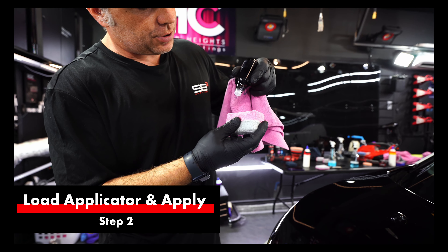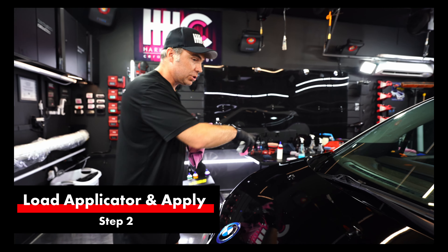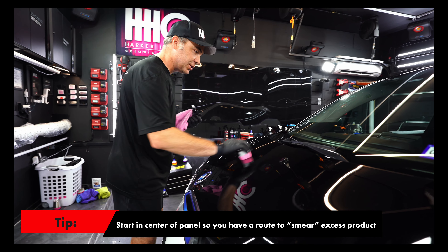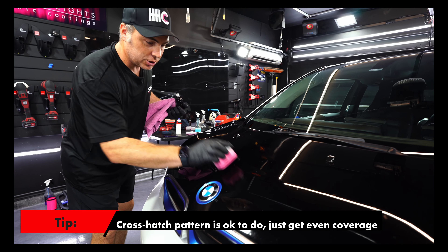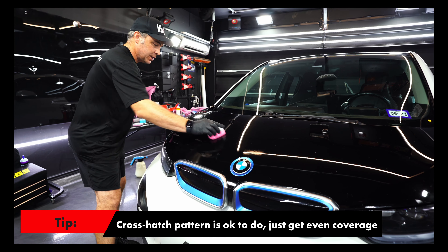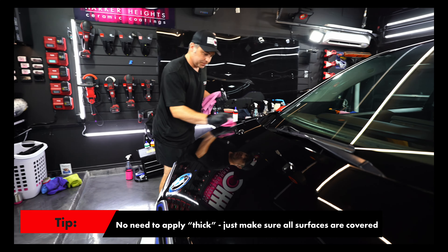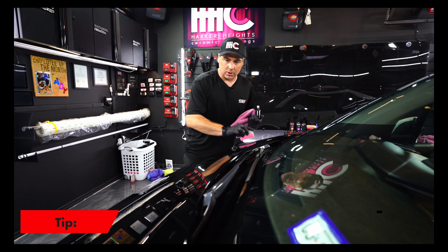You can probably put maybe 10 to 12 drops on the applicator, and I'm going to show you — it's going to coat this whole hood with just this and this applicator. I kind of start in the middle of a panel just in case, so that the concentration is in the middle and can be spread around. You may have heard that you can't go back and forth with this — that's not true. You can go back and forth; it's not going to wipe it off. You just need to make sure you've got good coverage, and that's the only thing that matters. Because it's ceramic coating, just a little bit is all you need. It doesn't have to be laid on heavy. SB333 is a one-layer coating.